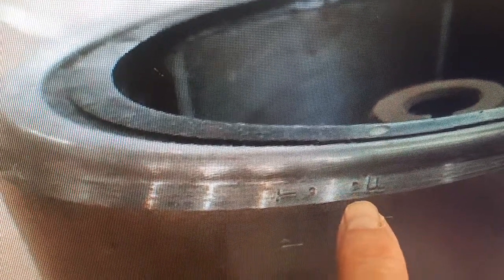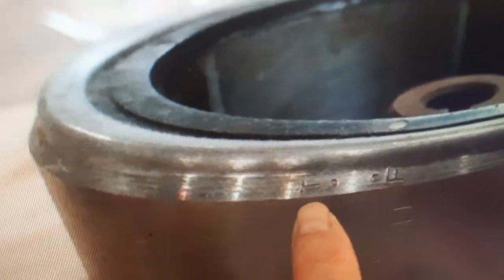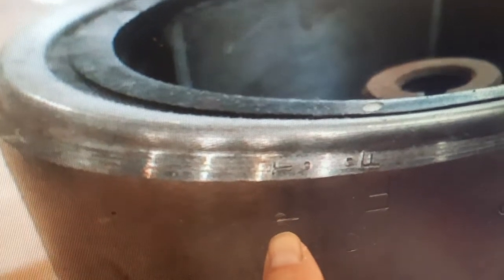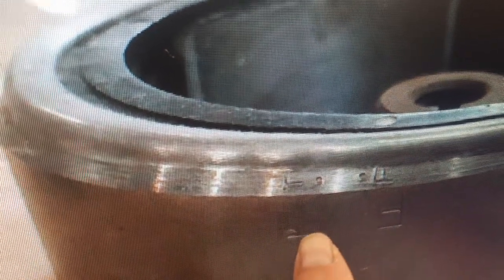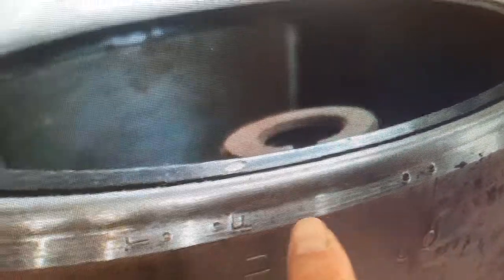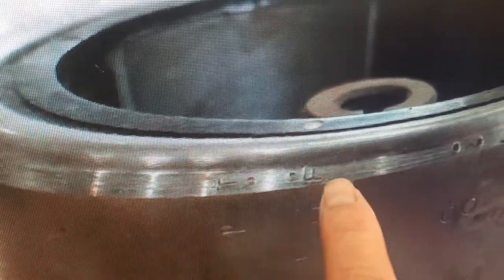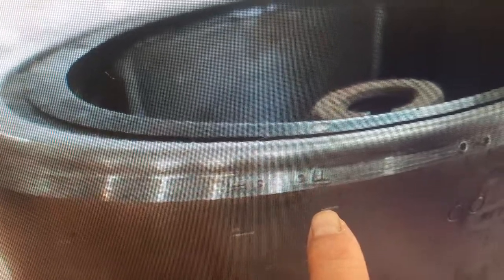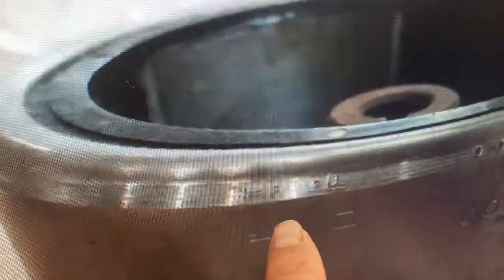Now once you see what this looks like, it's easier to look down the hole and see these little F's and the T. But even after walking away for a day, I can't make any sense of it. I think other people are going to have the same problem, so I'm making this video. Your F is the first mark you come to and the T is the second. There are two dots: firing and timing. This is what you would set up your pulse generator timing for, and this little dot is what you would do for your cam chain. I hope that helps people.